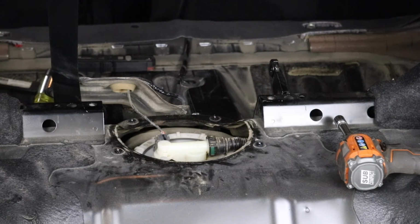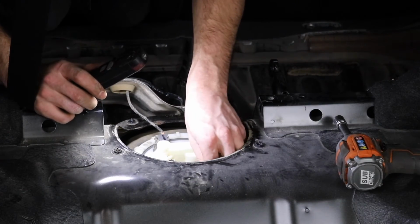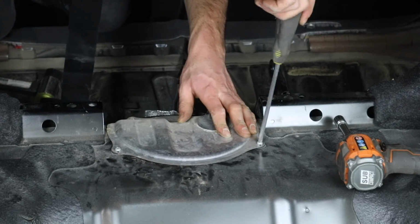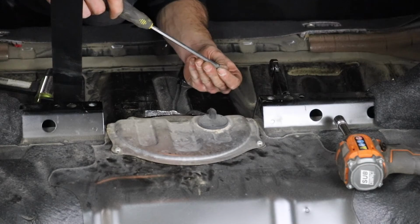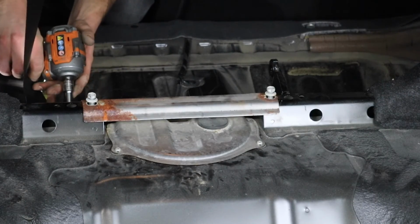And our fuel level sensor's still working because the level gauge is showing. And just to make sure, we got no leaks, baby. Honestly, I figured there would be no leaks, but it's always good just to double check. And also, these Phillips screws that hold this fuel pump on are so sensitive, do not go tight with them at all.